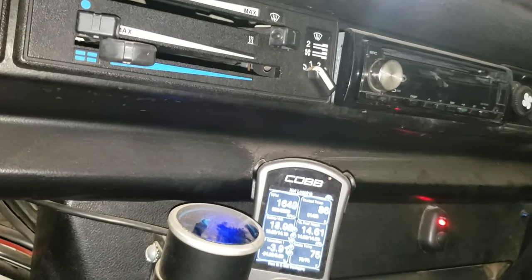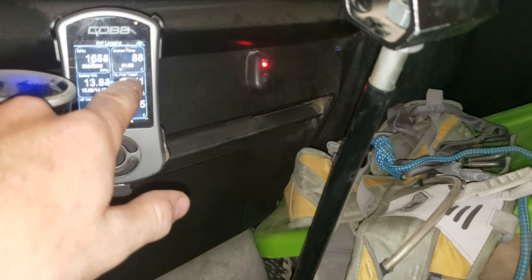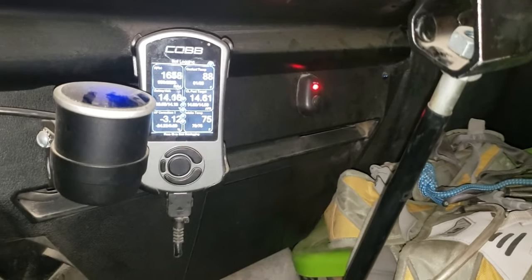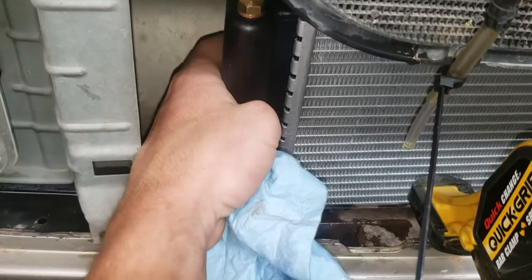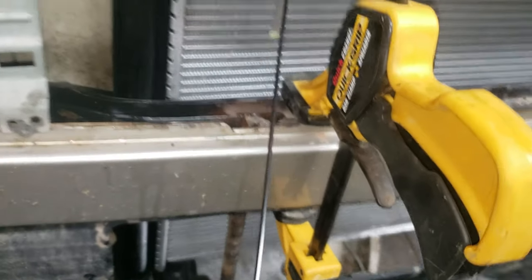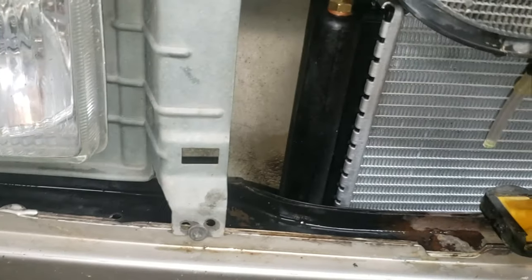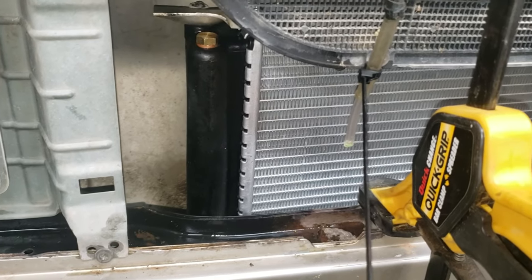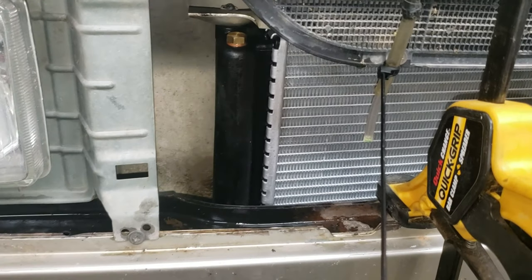While you're letting it circulate, make sure your heater valve is open — that's the second one down, needs to be all the way to the right. Monitor your temp to make sure nothing's getting too hot. If you have good flow, this plastic piece should start getting pretty hot. It's already very hot here, which indicates good flow. Coming out clean with no bubbles anymore, so I'm gonna let it circulate and then take it for a little drive with the grill off — bleed as necessary, but pretty much done.